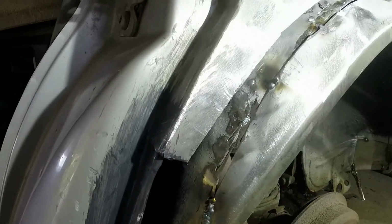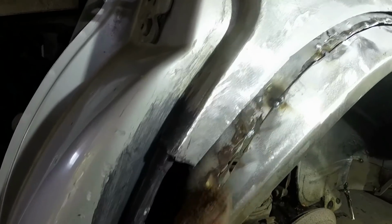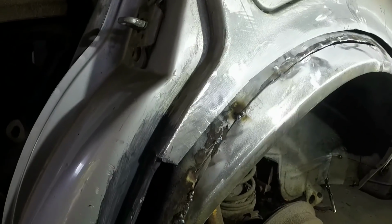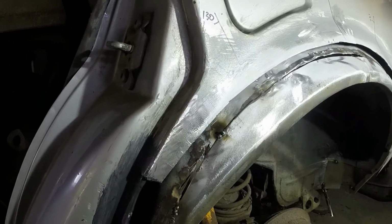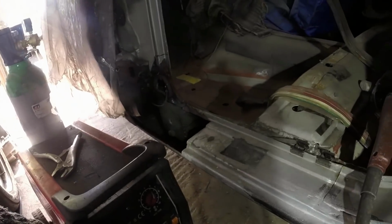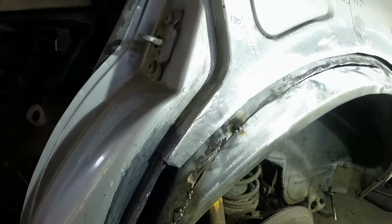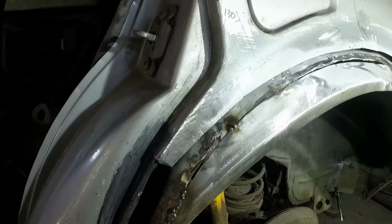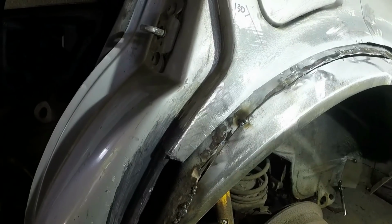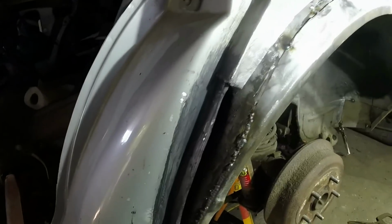With a bit of hammering, I have managed to close that area up. But this metal, this side, is so... I don't know how to describe it. It doesn't weld like normal metal. I think it's just so knackered. I'm having to have the welder turned down to its lowest settings, and then go very, very easy. And I'm going to have to join in all the cut slots first, and then fill in the rest. So it's going to be quite a long, laborious weld, this bit.